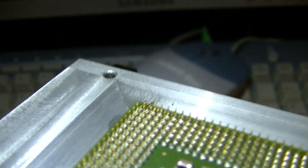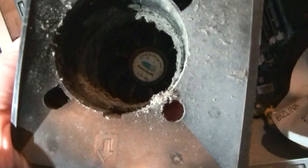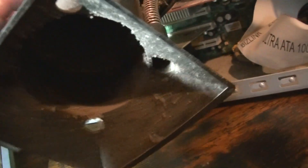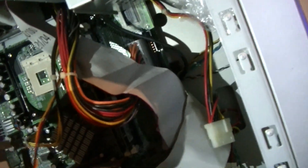The processor was forced out of the socket, damaging some of the pins and destroying it completely. I think it's safe to guess that this PC was likely thrown into the delivery van, and despite being packed very well inside a box with layers of wrapping, the shock must have caused the clips on the cooler to detach, which is probably why it fell out when I removed the side panel.